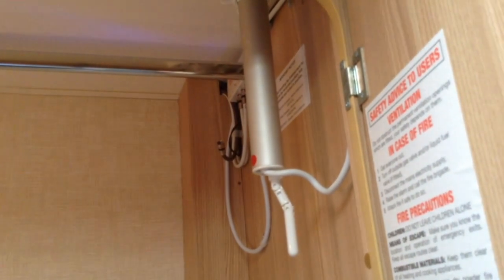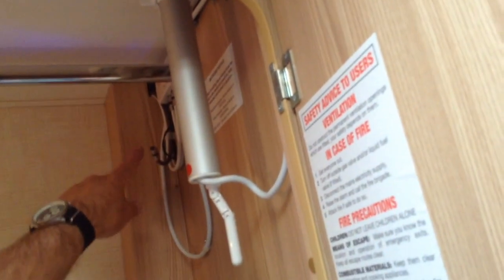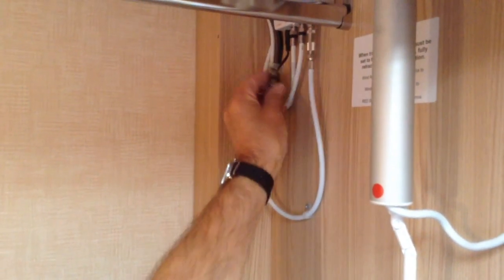Undo the collar at the top, push it up, rotate it around, get your best signal you can. You've also got an external TV point. So if you're using the point in the battery box, you need to take the feed, which is this one, which is the feed off this one. And if it's pulled across, it should go into there.